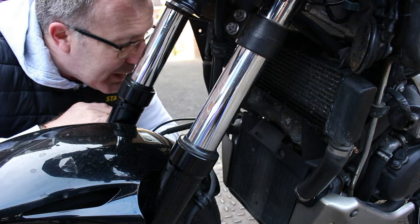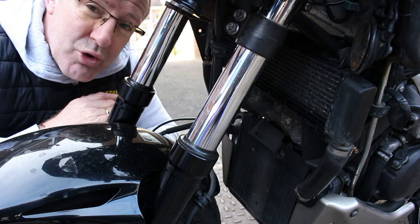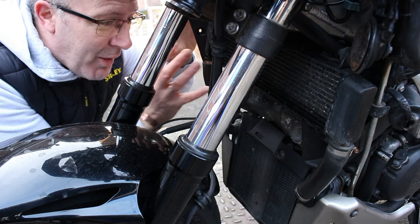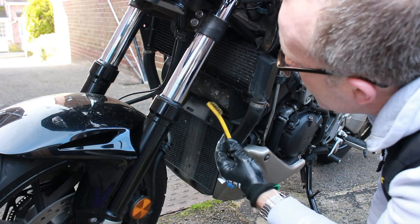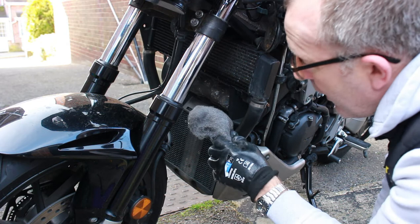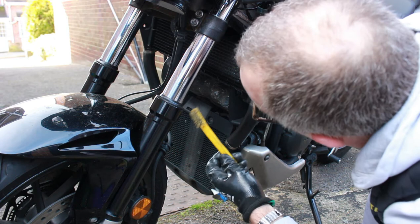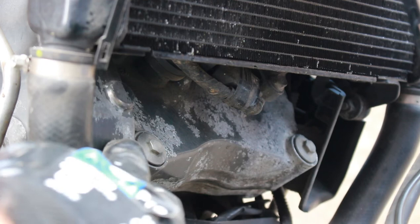Today I'm going to tackle this bit here - basically rub off the paint that's loose, then mask off the bike and get some spray paint on this section so it all looks nice before we put the side panels back on. Once the side panels are back on they do cover an area of this that won't be seen, so it's much easier to do it now. I have a very small wire brush with just brass bristles - not too harsh like a steel wire brush, these are a bit softer. I also have some fine wire wool. I'm going to start with the brush and see how loose and flaky this paint is. And there we go - pretty much all the loose paint taken off with that brass wire brush.